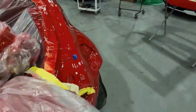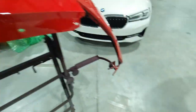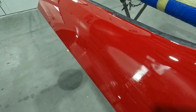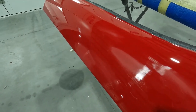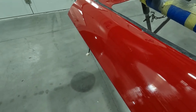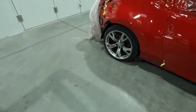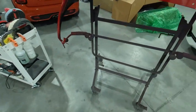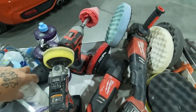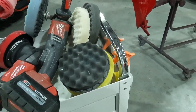On the body we've got three nibs on the bumper, and we have a couple nibs over here — just like that quarter, it had a cluster of them. That is probably from me coming up on this and leaning over it, just changing the air makeup in the booth. So we've got some dust right there, some dust in the quarter, and a couple nibs on the other spots. You guys see here I have everything on my mobile cart — it's a little messy at the moment but everything is on it and I'm able to roll over to wherever I have to get my stuff buffed out.